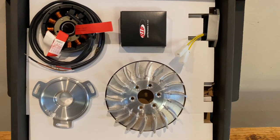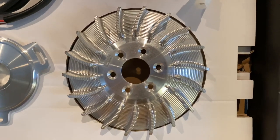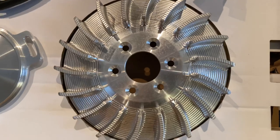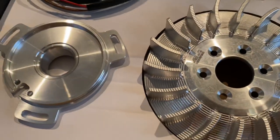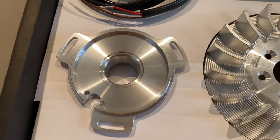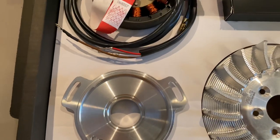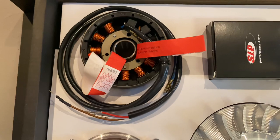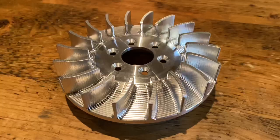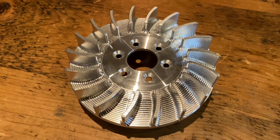In terms of technical specification, it's 110 watts available from tick-over for greatly improved lighting. You can also power additional electrical components and USBs. It's a plug-and-play installation — they say without a strobe lamp, due to the precise ignition point markings. It's the first time I've used one of these, so being a belt-and-braces guy I will use a strobe for setup, but if they say it doesn't need one, then it doesn't need one.